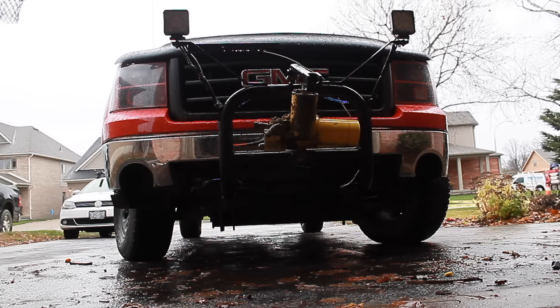What I want to do today is we're going to be installing a three-inch leveling kit. That's three inches in the front, two inches in the back. So really, you get two inches of height overall, and then an extra inch in the front to give you that leveling portion. And that's really important for me with the snow plow. So let's go ahead and jump into it.